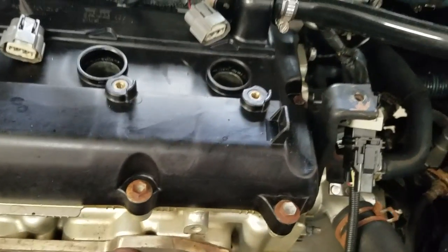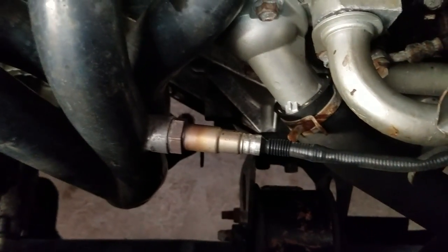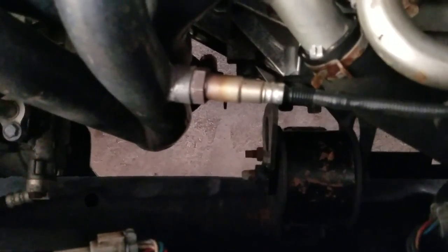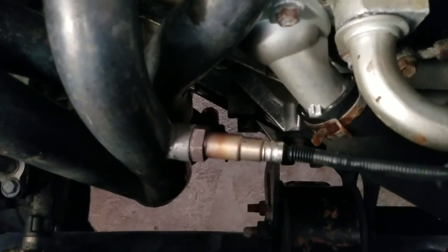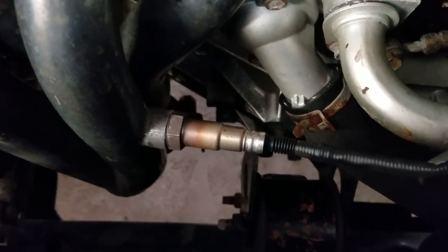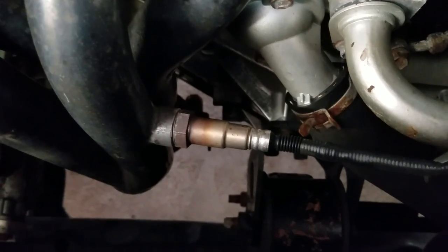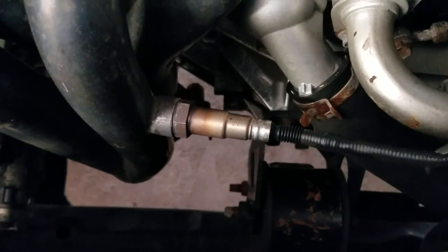The engine is sucking in more air than the MAF is telling it it should have, so the fuel injectors aren't adding enough fuel. My O2 sensor — which is actually an AFR sensor — is reading it. What's weird to me is my fuel trims don't seem off. You'd think they'd show the engine running lean and be adding fuel with high long-term and short-term numbers, but I'm running around zero — short term no more than plus two or three, and long term at 0.8 most of the time. I don't understand it, but at least the smoke machine will help me narrow it down.